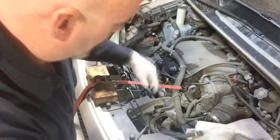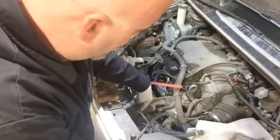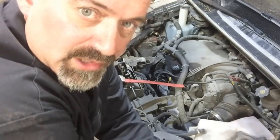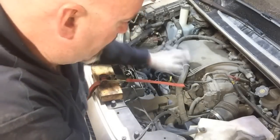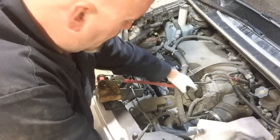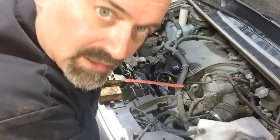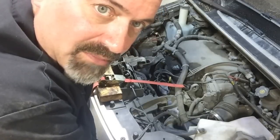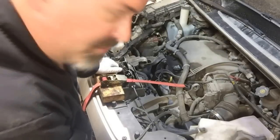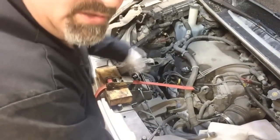The first step of the process here is to remove these front engine strut mounts to the upper core support. There's four mounting bolts and two actual mounts on the core support, and we're going to remove all four bolts. I have secured a ratchet strap to the engine pickup point here, coming along the front of the motor and the front of the vehicle and attaching to the lower frame of the vehicle. I've put a little 2x4 here to keep from damaging any of the components on the bumper cover area. So let's bust these off.